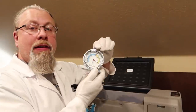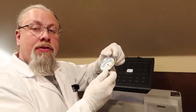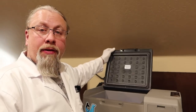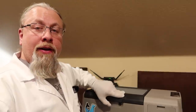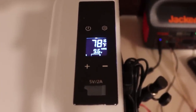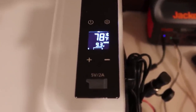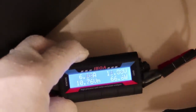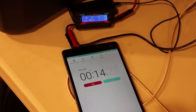We're now going to test how long it takes for the Lion Cooler to go from room temperature - about 76 degrees - to 32 degrees Fahrenheit, and measure how much power it takes. Then we'll do the same test down to zero degrees Fahrenheit. Here's the beginning of the test - starting at 78 degrees Fahrenheit in max mode, pulling about 66-67 watts.